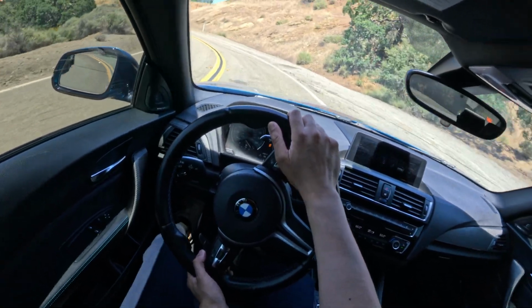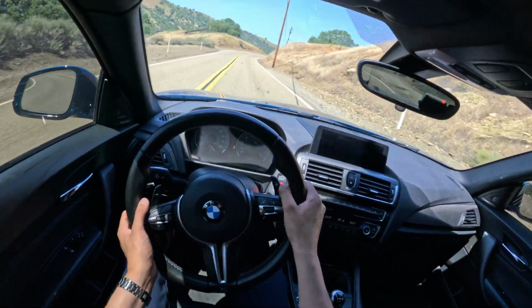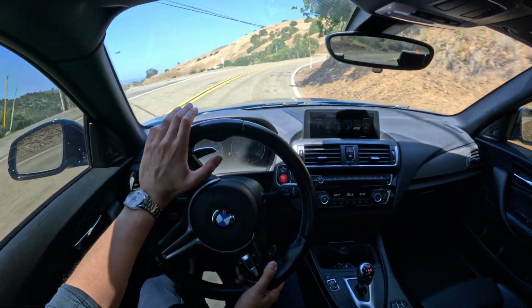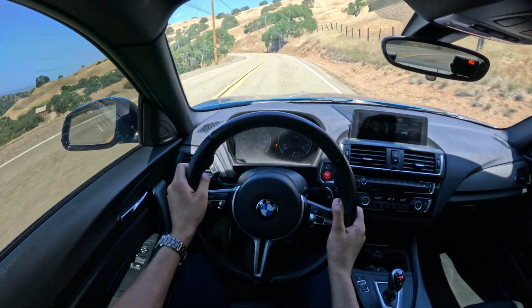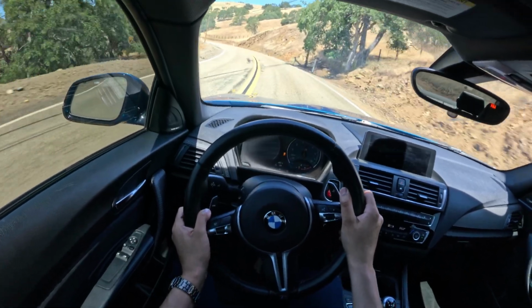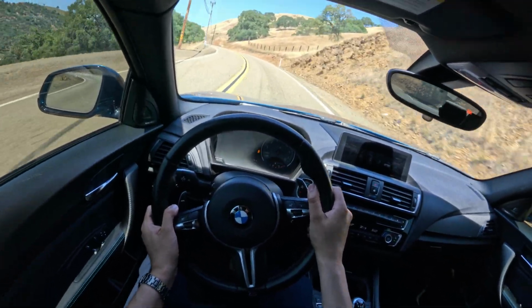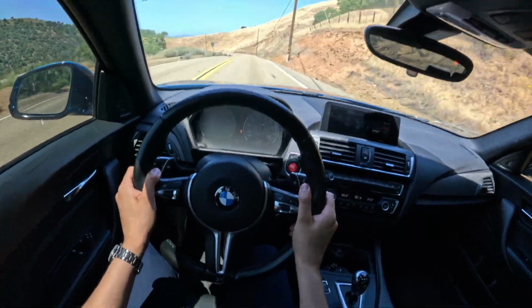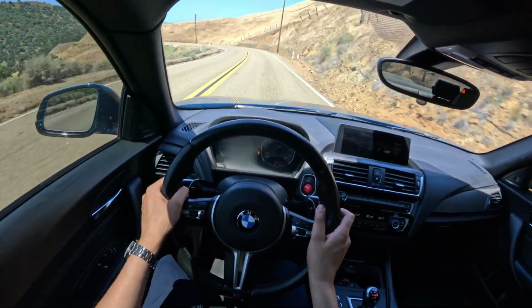the steering here has a lot less through the wheel. It's also artificially a faster ratio to make the front end feel more responsive, and that contributes at least to the nervous feeling. And it's what a lot of manufacturers have been doing, especially BMW. Look at the G80 M3.